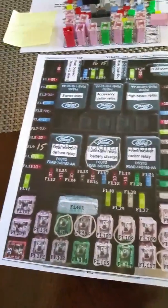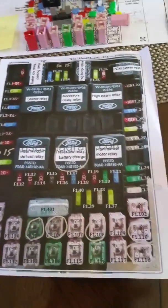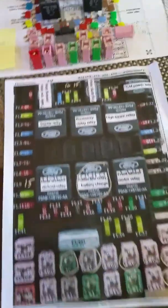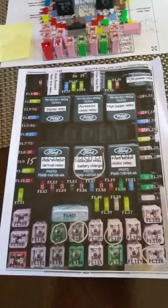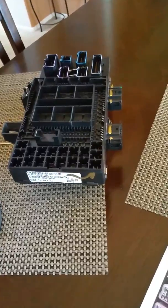There's a circuit board in there, so it's very simple. The relay's got five pins on it. F8VFB-A is the part number — R303. Ford won't sell you one. They'll happily sell you this whole entire box, though — $500.00 and a couple hundred bucks for them to install it for you.